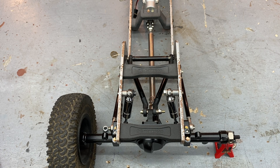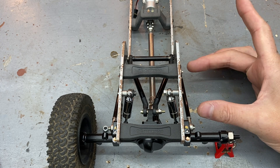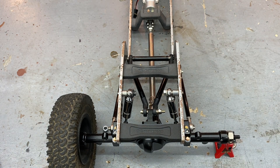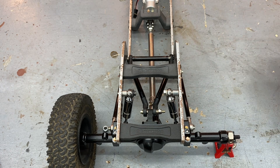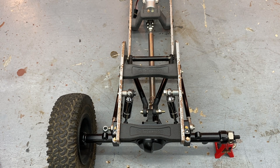Shock configuration and four-link length — it's all up to you. I typically use 40mm rods for my four links to keep it nice and tight. This one is a little longer because I didn't have any 40s at the moment. You can get these rods on Amazon too — they don't have to come from RC companies. They're also used in computers to keep circuit board layers apart, called standoffs. M3 standoff brackets come in all kinds of shapes — smooth or hex — and you can make a four link out of them in whatever size you need.